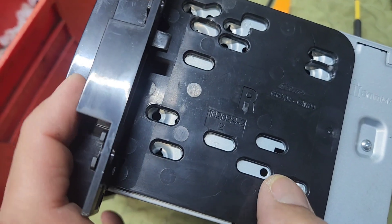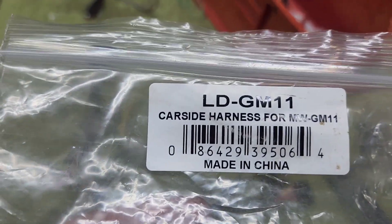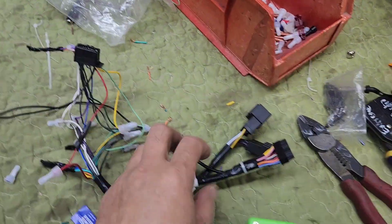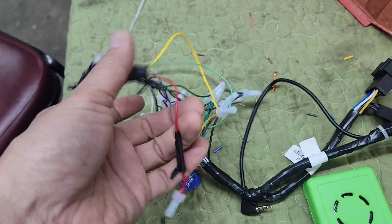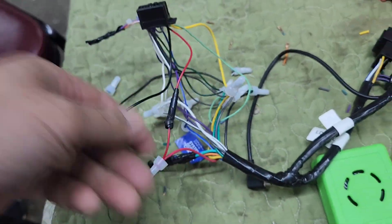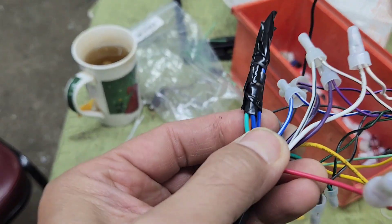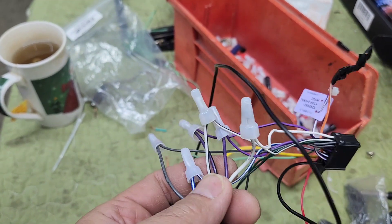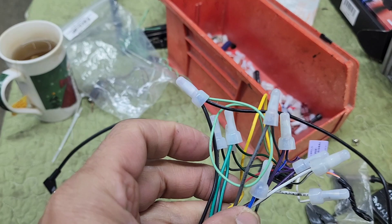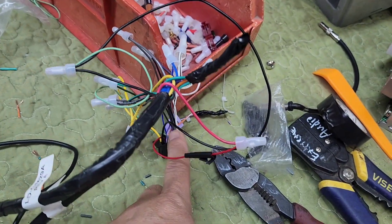You flip it on each side so you can put the screw in — flip it and push it down, then slide the screw in that came with the radio. It's a wiring harness for MWGM-11. I tried to program the steering wheel control but it's not compatible. Red is accessory to red, yellow to yellow. But when you're installing this model, make sure light green and purple are not hooked up. Gray, gray-black, white, white-black, purple, purple-black, green, and green-black — you need to hook those up to the same ones.